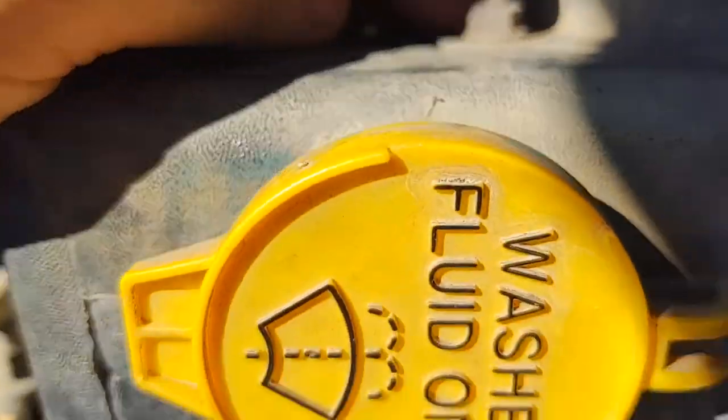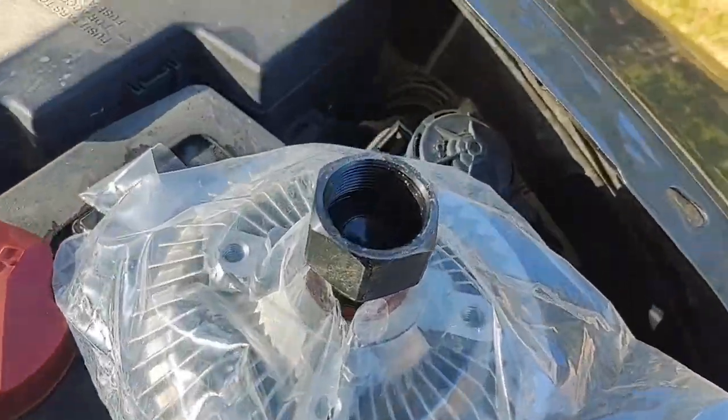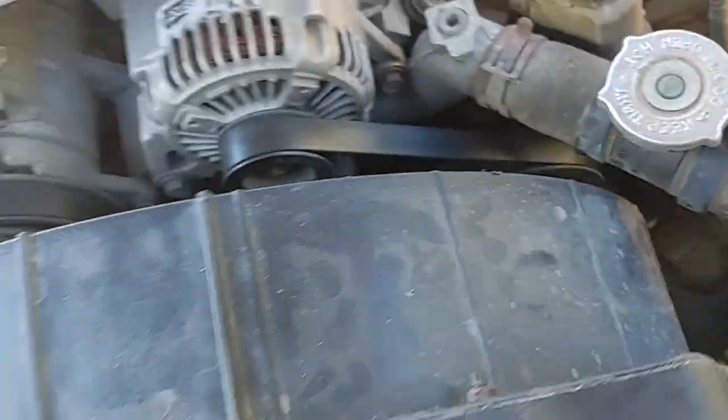The shroud is removed — it clips in down there right where you see that seam sticking off to the side, right there in the center of the screen. It unclips from there, and on the other side it clips the same way. All you have to do is unbolt one right there and one right here to get to that fan, and then you can take your fan off or put your clutch fan on, whatever you want to do.